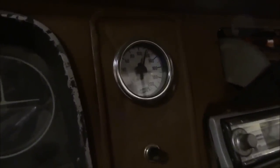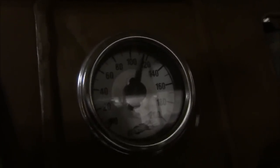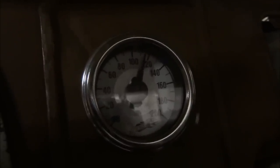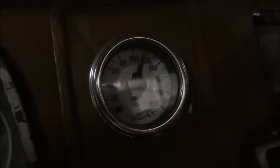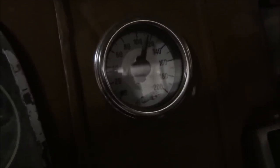There's my tank gauge. That's really important so you can know if your pressure switch is working correctly on your compressor. The pressure switch tells the compressors when to turn on. So my pressure switch is turned off right now, but I have it set to turn on at 145 and shut off at 180. So right now it should be on, but my truck's not on, so it's not. Those are important to have because you want to make sure your pressure switch is actually working. Otherwise, you could have a bad pressure switch and your compressor just keeps going and never quits.